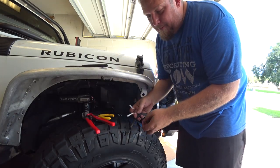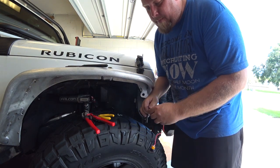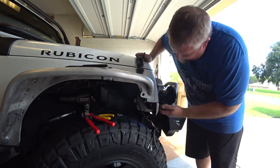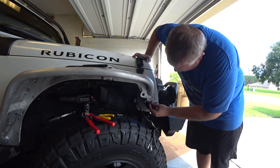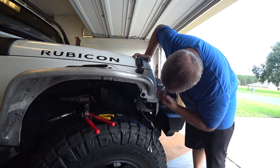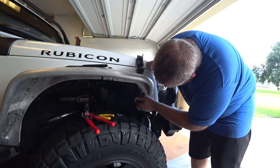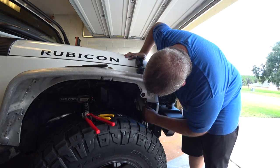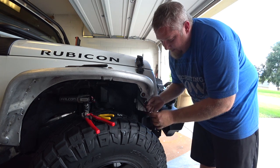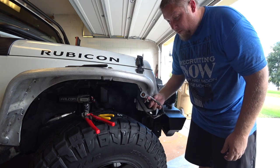Black and black. White and green on the red. Connect them together like so. The trick to getting this light in this hole is to take this rubber grommet off, stick it in here, get it all wet — you can use Windex, spit, whatever. Run the wires through, then push this bad boy in like so. Then connect these and tape it all up.